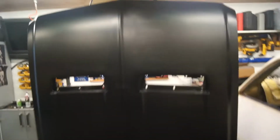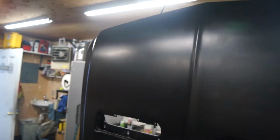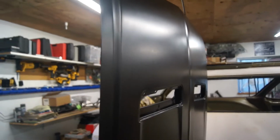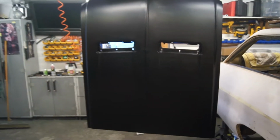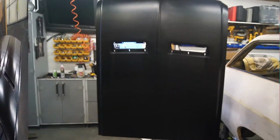The thing I like about this is it's only been like four or five minutes, and you can see the nice sheen that it's accepted. It's laid out really nicely. I put it on super stupid thick, and I got one run right here, but that's because we triple coated that right off the bat. So we'll go for another coat here because this is almost flashed off, and we'll see if I can get a nice good coverage so that the rust doesn't poke through again.